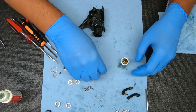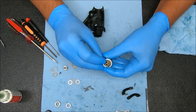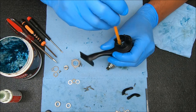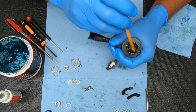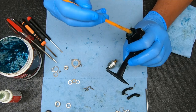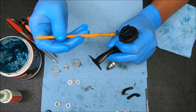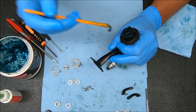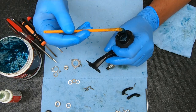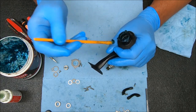While we're here, we can obviously stick this bushing in — so the whole setup looks just like that. Now we can go ahead and add a generous amount inside here. I get paranoid with this because getting it frozen in there is sometimes just a tough process getting it out. I've never had one I couldn't get out, but sometimes bearings get damaged and have to be replaced — you can just avoid that by doing this step right here.